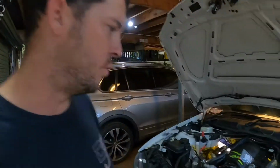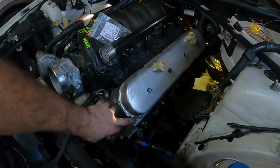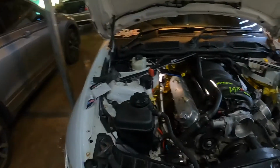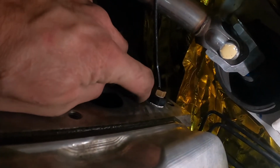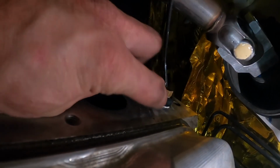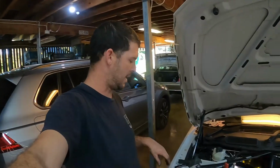Righto guys, also to add on to the E46 stuff, LS related. So both heads are mirrored. So this water port is the same on this side. So if you ever need to do an extra gauge, there's a fitting you can buy down in here. This one, little black fitting. You can buy that, it adapts to the head, and you can put a water temp sensor in the end of it. Sometimes the sensor is long, so you have to drill the fitting out a little bit, so then it gets a bit sketchy. But other than that, that's a good little trick to help you put another water gauge in if you ever need to. And it's in the same location as the computer, so it'll read the same.